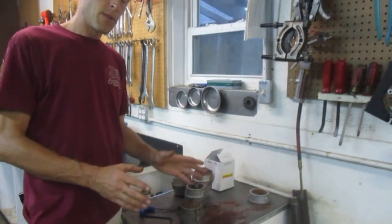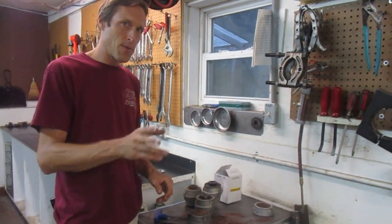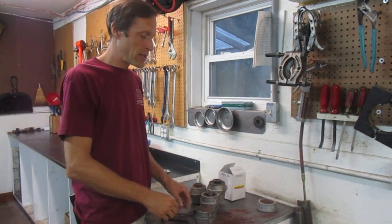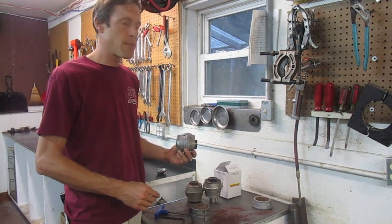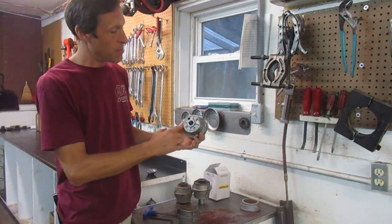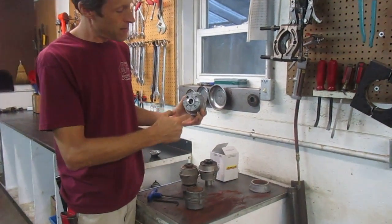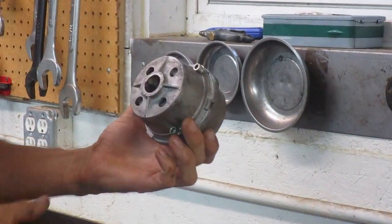There are several different types of clutches in walk-behind tractors, but this is one particular type. We're going to have other videos putting up on the internet in the coming weeks for all the other different types of clutch. But this is the type that is bolted together — meaning there are actual allen head bolts holding the two halves of the clutch together. On this one there are three allen head bolts. On the Gorilla brand clutches there are four bolts rather than three.